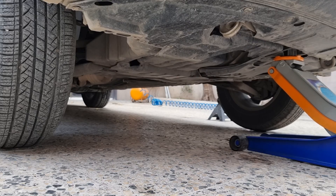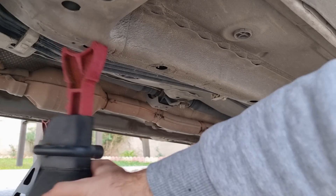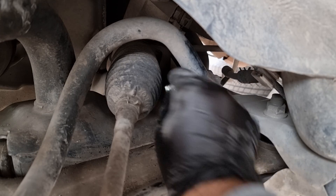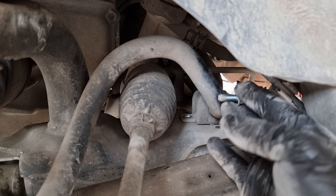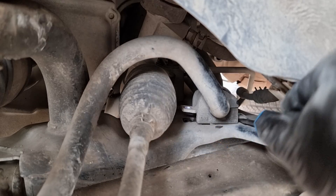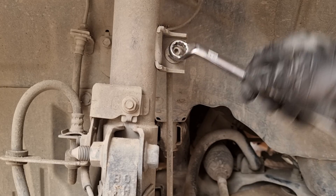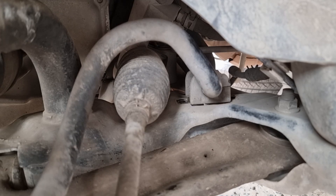The procedure will be the same for most cars. We're going to jack up the car and put it on a jack stand. When replacing sway bar bushings, both wheels should be up in the air — it will be much easier to take the old bushings out and put the new ones in. After undoing two bolts, remove the plate, but you can't remove the sway bar bushing directly, so we're going to remove the sway bar link and then the sway bar gets free.